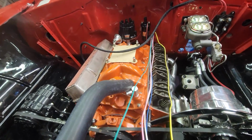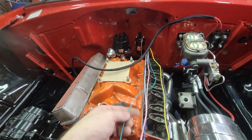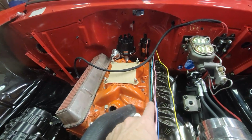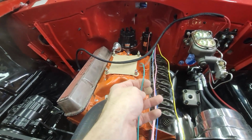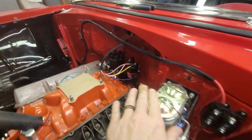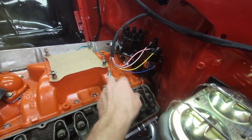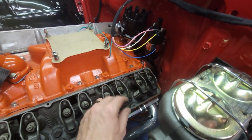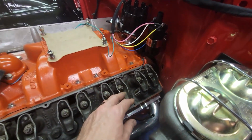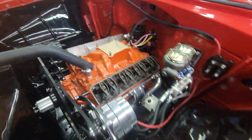And then the oil pressure sending unit, I'm going to have to do something back there because there's one tap back there, and if I do two sending units, if I do the idiot light and then the gauge, I'm not quite sure. I don't know what I'm going to do just yet, but we'll see. All right, now that's all done. So I got everything pulled to where it needs to go, roughed in. Only thing left is the oil sending unit, which I need to see what the sending unit looks like before I put a plug on it, and then the water temperature sending unit similarly.